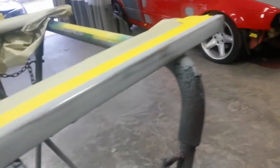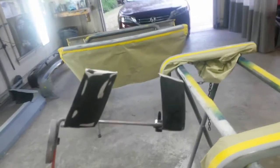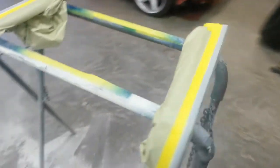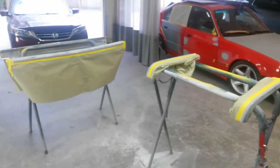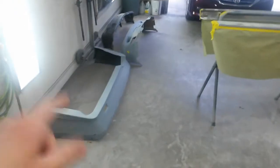Ready for epoxy again. I've got so much cut-through to the metal that I'm gonna go ahead and just epoxy it again. I've got the two end caps that need to be repainted here on my mirror holder — actually four, but two need epoxy and primer; the other two I could just scuff and seal later. I'm going to get the epoxy on, only one coat this time. Got them all blocked out. There are still a few high spots where I cut down to the metal, but I can build up over that with the primer. I'm not going for 100% perfection, just trying to get them as smoothed out as I possibly can. After the epoxy it'll get three coats of urethane, and I'll be back when I'm ready to paint.